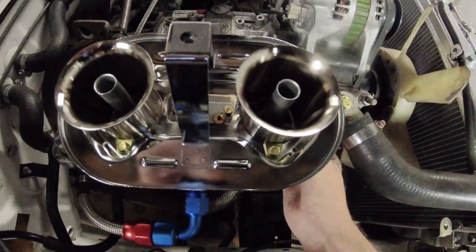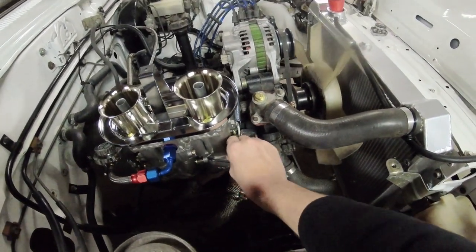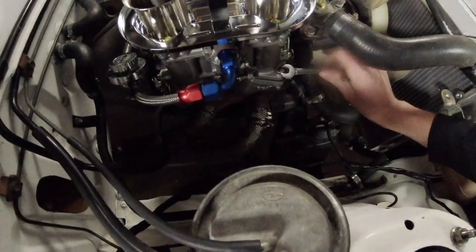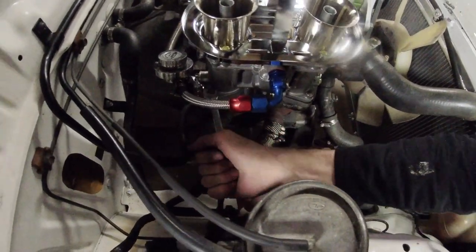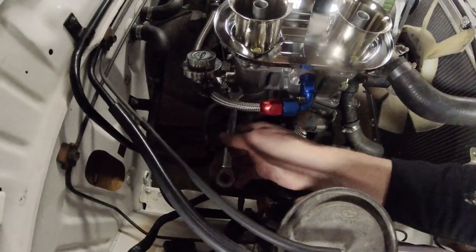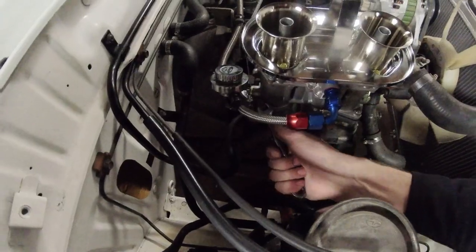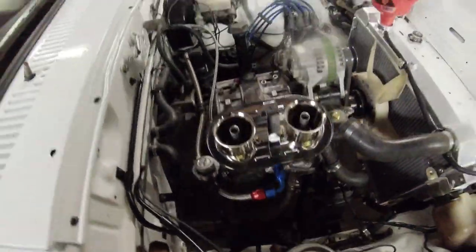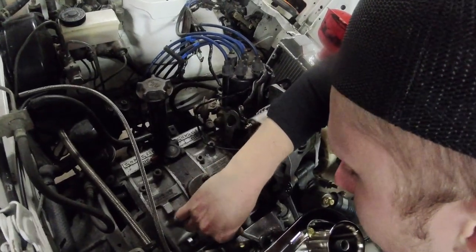The gasket's a little soaked — did it dump a bunch of fuel out? This gasket's wet, you can see that. Shouldn't be leaking that much so we're going to tighten that down. These are thicker gaskets and I don't have the little O-ring seals on these — I may have to get a set of those for the 48 IDA, but I need to find them first. Either way, the car runs.